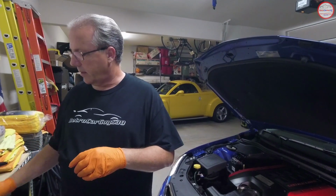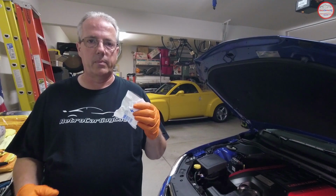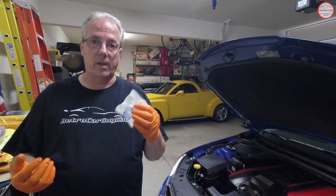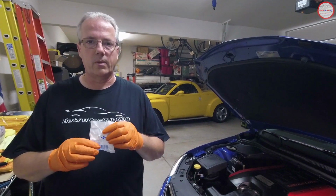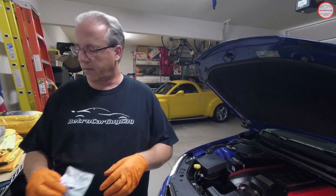And I ended up picking up a 1-inch outside diameter copper tubing cap. I found some plastic PVC pipe stuff that was like 1.25 inches. Seemed a little bit too tight overall. Maybe it would have pushed in there okay, but I didn't want to stretch out the hose at all. So this is 1 inch outside diameter, because the hose that I'm going to be working with is a 1 inch inside diameter. So I figured that was a reasonably good match for that.